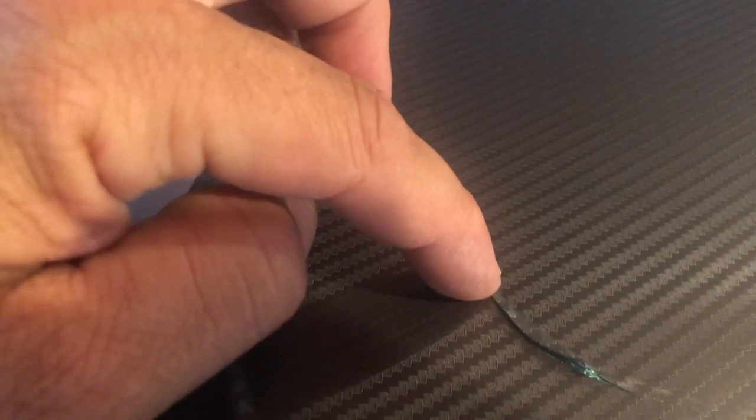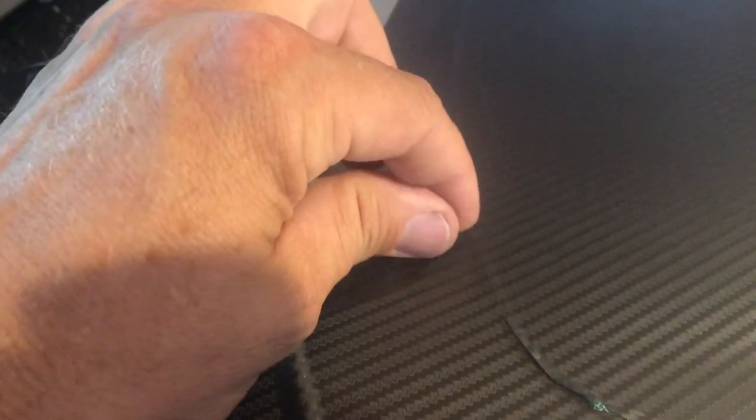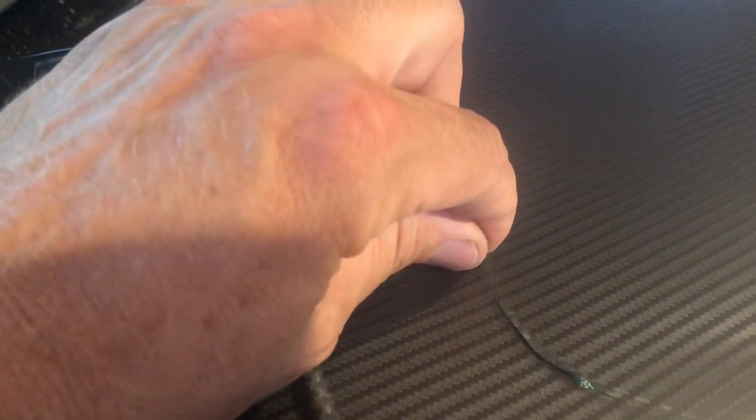That was pretty tricky. What I did was pull the knifeless tape string up to a certain point and then do the same thing coming from the other direction. I took my knife and cut a little fine line — not all the way through — then used the knifeless tape and started pulling it into that little indentation I created, and it followed right through without any trouble. Now I'm going to go ahead and peel off the rest, and I do want to be careful up here as well. I'll definitely check out this area when it's finished to make sure it's nice and straight.